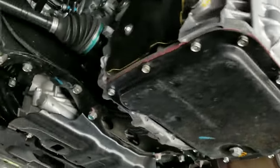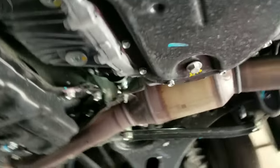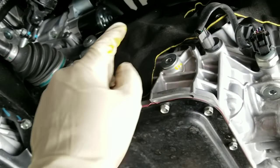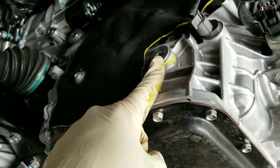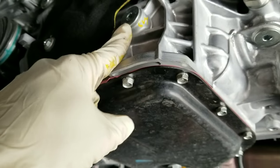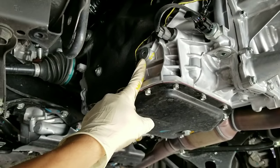I'm gonna make this video quick and to the point. First, we have the CVT transmission assembly. This is the fill and check plug for the CVT fluid. It's not this, it's not this, it's not any of this stuff — it's this one, on the left-hand side of the vehicle near the rear.